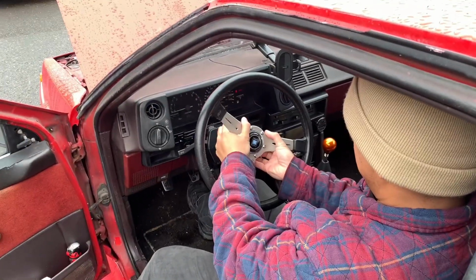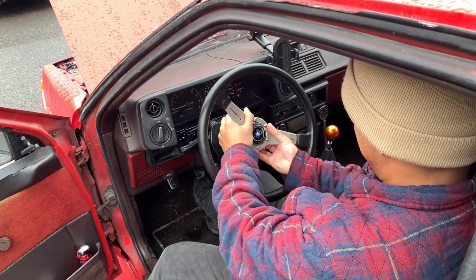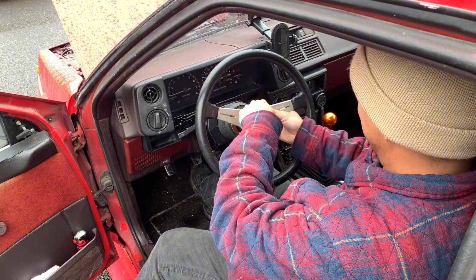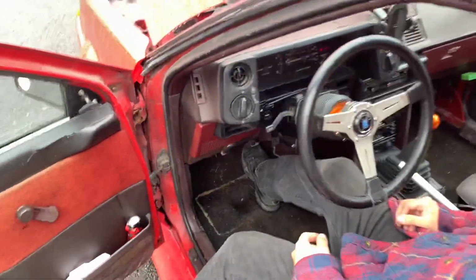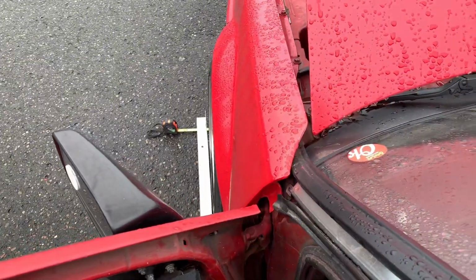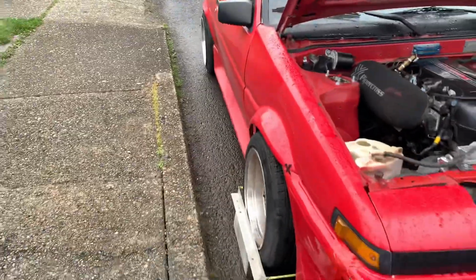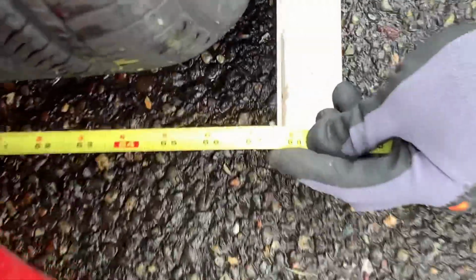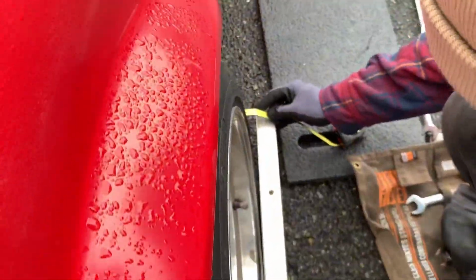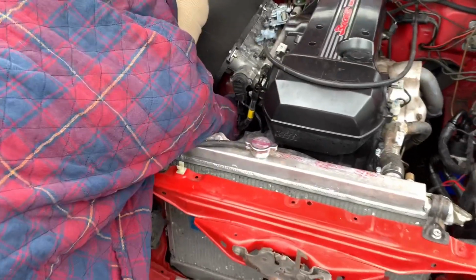So Jason driving straight, that's where the wheel's pointed. So if I turn the wheel one whole slot like this, you'll be straight, but you'll still be 1/2 inch out. And it's only this wheel. I think it's just this wheel, it is obviously pointed out. Okay, so 67 and 9/16. 67 and 3/4. Okay, so yeah, we're still like 1/4 inch toe in. Learn something new every day.